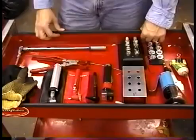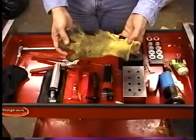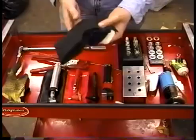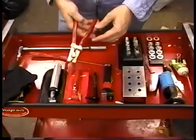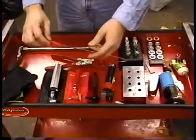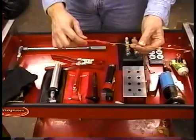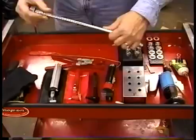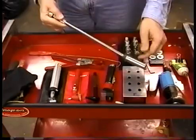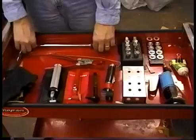Let's look at some of the tools I use. First, you've got to get the spark plug wire off, and we don't want to get burnt, so some really good high-temp gloves for reaching in far. Some forearm protectors definitely come in handy too. If you're in the automotive industry, you've probably seen spark plug boot pullers — for pulling off one spark plug at a time to find the dead cylinder. I also made one out of a coat hanger for reaching in through the fender well to pull the spark plug boot off. Next, we've got to pull the spark plug out — I've got a short handle ratchet with a spark plug socket swivel and a long extension, perfect for getting in through the fender.